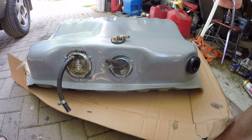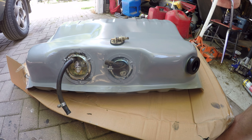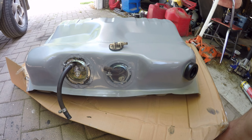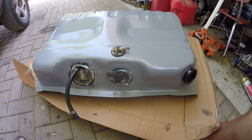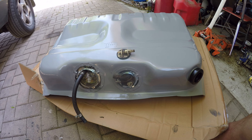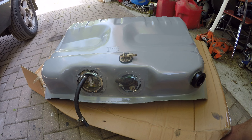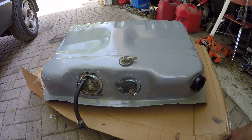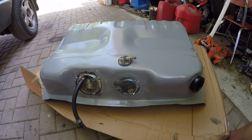Installation is the reverse of removal. I'm going to make sure I use a piece of cardboard between the jack and the tank to keep the paint relatively nice. I'm going to put the insulation and protector that the previous owner installed on the last tank — it's held up well and looks like it's protecting the tank without building up moisture. I might shoot a quick spray of Cosmoline on it regardless, just for a little added protection.